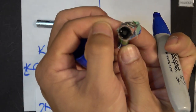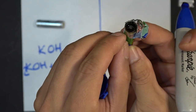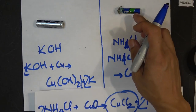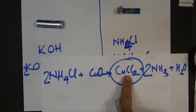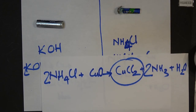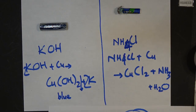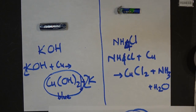I'll show you the carbon rod here on this battery — you see that rod right in the center, that's a carbon rod. When you use a zinc-carbon battery you're going to see this bluish color corrosion. If you use an alkaline battery like this one, you get copper hydroxide on the terminal.